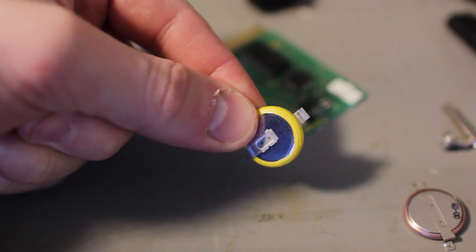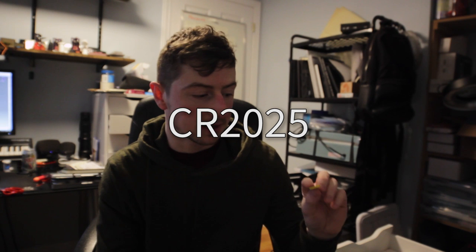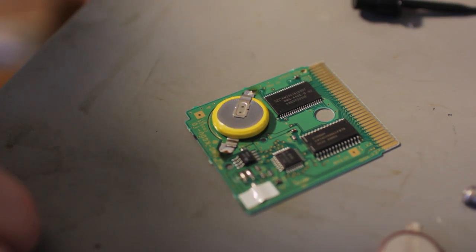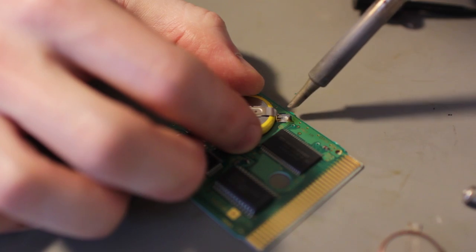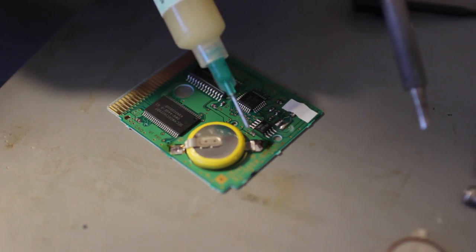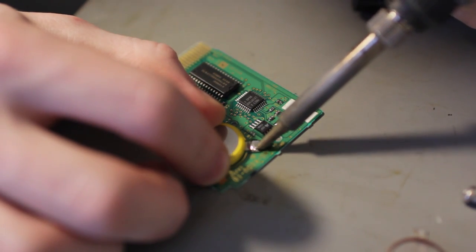Then you're going to get one of these new style batteries. These are three volt, they're not rechargeable. In this case it's a CR2025. I believe some cartridges do have smaller versions of this, so you should open up your cartridge before you order them. I will post a link below where you can get this battery. You'll find that on these batteries one side will be labeled — that's often the positive side, so you can see there's a positive mark on there. So what I like to do is just solder one side, again using some flux just to make everything clean. You don't really need to add any extra solder — you can use the pre-existing solder that's on there. Then you heat up one side, heat up the other side, and you should be good to go.